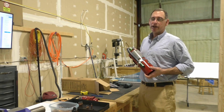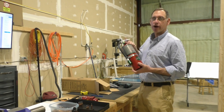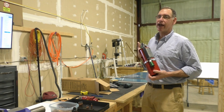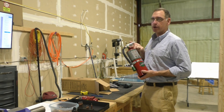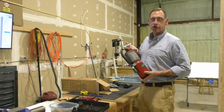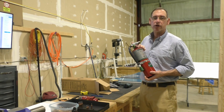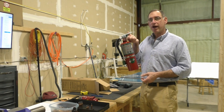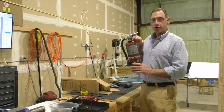There's not a whole lot in an airplane to burn in the way of a Class A fire, which is another reason this is a good aircraft-grade extinguisher. I do have an ABC fire extinguisher in the hangar, so if something wood or standard combustible were to catch fire I'd have something to use on it. I'm saving the halon for fires in and around the airplane where it's more likely to be a fuel fire or an electrical fire.